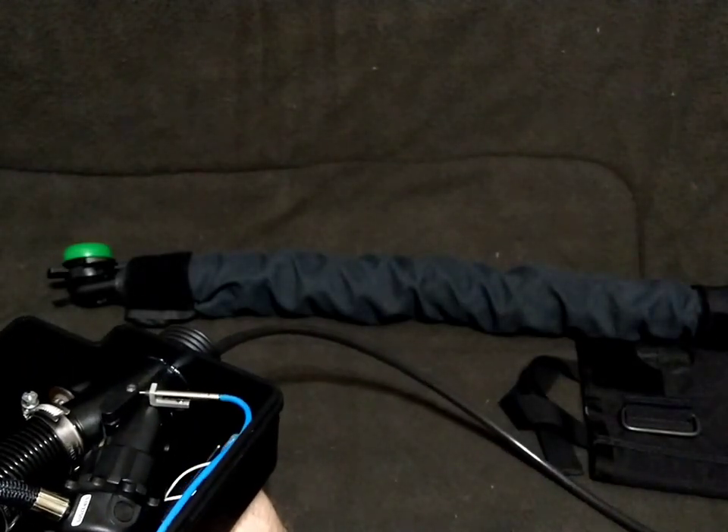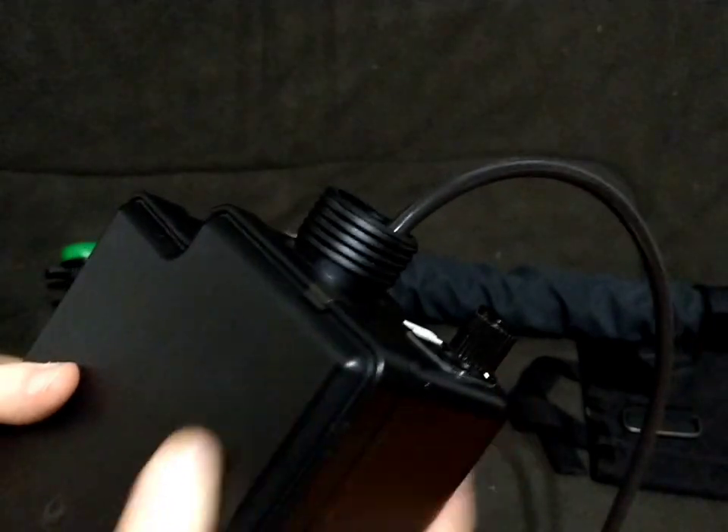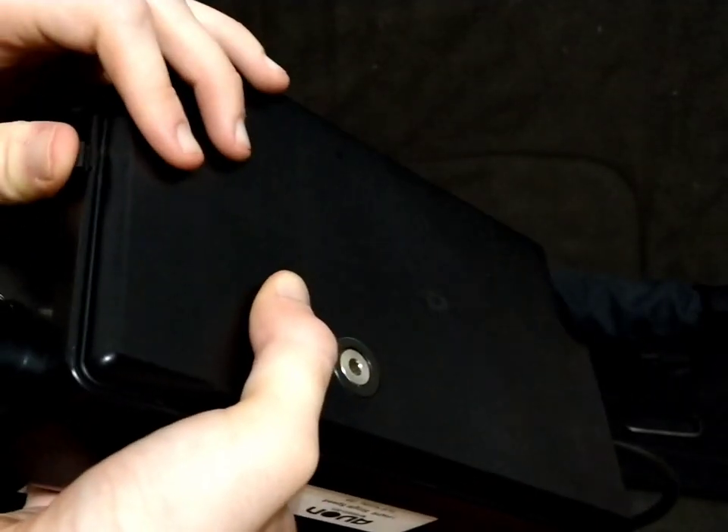I might as well show off the reassembly, which is pretty much the reverse of disassembly but simpler since no screwdriver is involved. Reposition the back cover on — sometimes it gets stuck, so make sure one side is fully seated before installing the clips or you'll have to undo them all again. Take the hooked portion of the clip that doesn't have the lifting tab, find the first accommodation right behind the blower switch, hold it down, and press until it snaps into place. I'll take this over the C420's multiple wax-filled screws, but they could have at least put a gasket in.